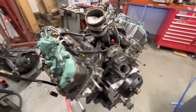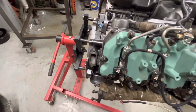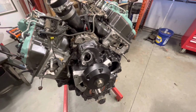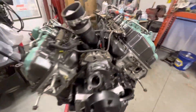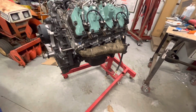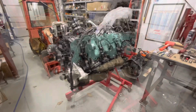We're doing pretty good. The intake manifolds are in, the Y bridge is in. I got to install the turbo. I got to reinstall the coolant block off piece there, and then get to work on the cooling system and belt drive. But it's looking pretty good. No regrets on the Detroit Alpine Green for the upper valve covers. It's coming along. So I don't know what the next clip is going to be, but you guys are going to find out right now.